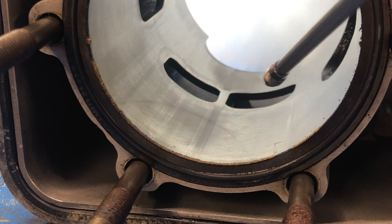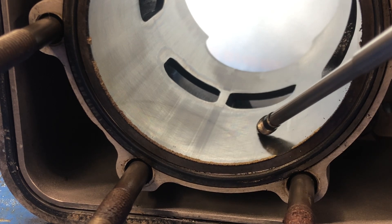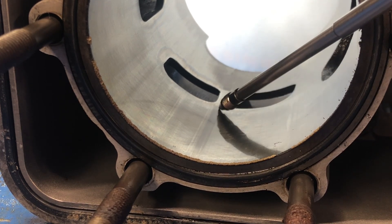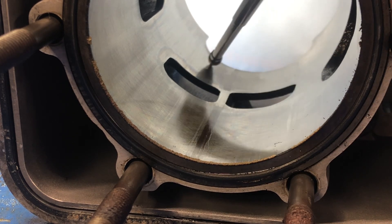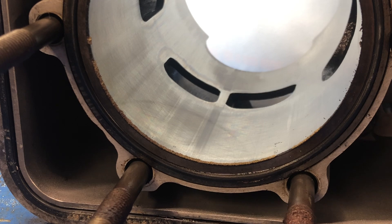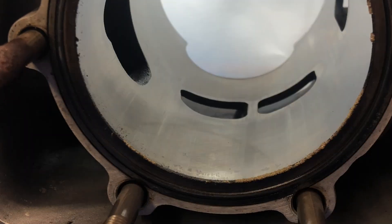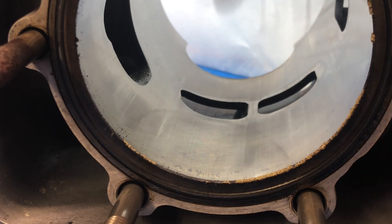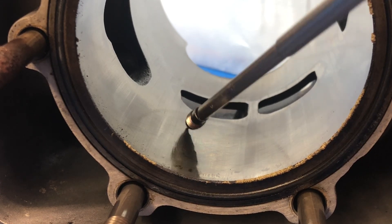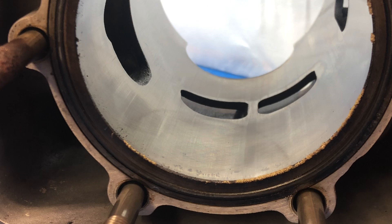This all looks oily and shiny but it's not — if you rub your finger on there there's no oil. It's all shiny from resin. We can see why the rings are not going to seal because they can't even get to the metal anymore. There's a dark striation in here and then a rather large deposit where it's much darker — thicker resin. Flipping the cylinder over, pretty much the same: very shiny. When I rub this there's no corresponding cross-hatch feel, and it's quite a bit darker down here where the resin is thicker.